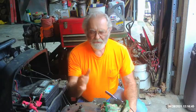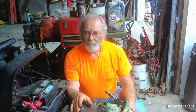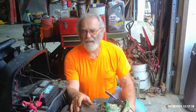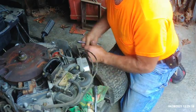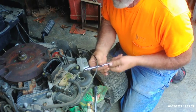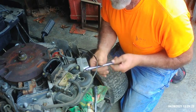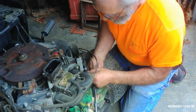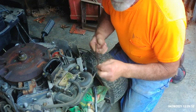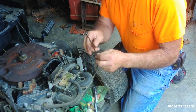Well, we went through the process to determine that the keyway definitely was not the problem. I'm going to pull the valve covers and take a look at the exhaust valves and the valve settings. It should be nice to see that something jumped off the rocker. Look at there — there's my rocker arm down here. Check this out — I got a bent pushrod.